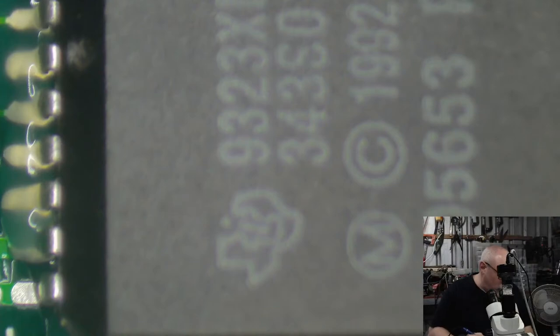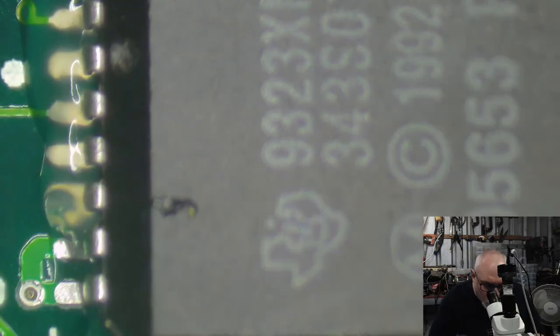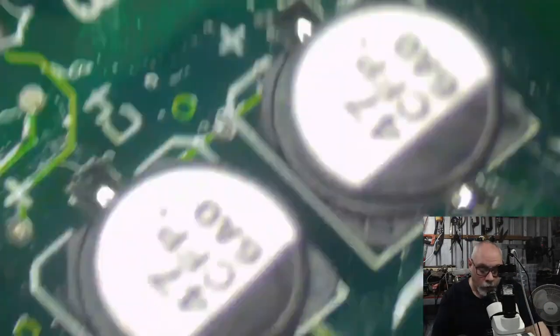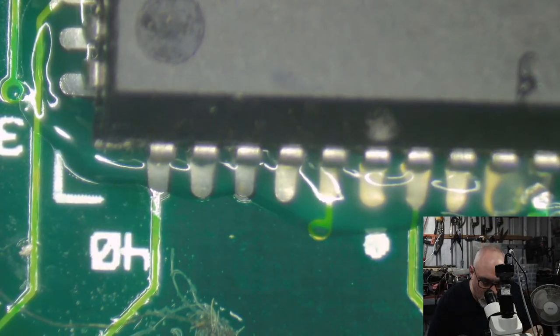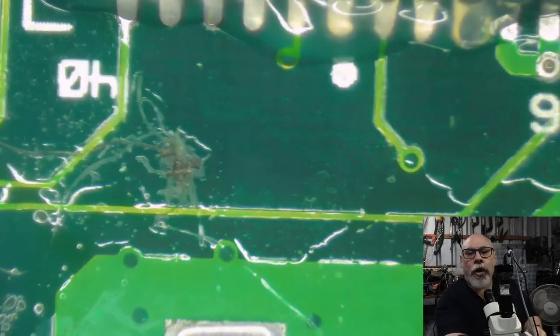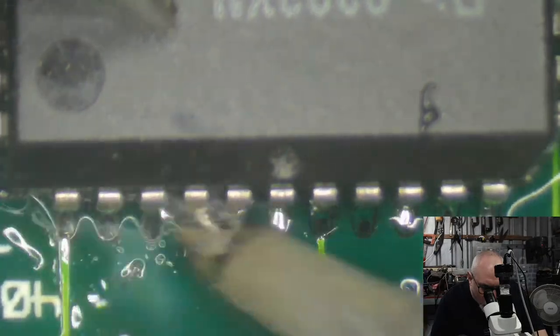it's basically when you check the voltage on it, it's pulsing up and down. What usually happens is it tries to power up, then the voltage is wrong because of a short or something like that. It's pulling the voltage down, making it lower than it should be. It then goes through a chip that says, hey, is all the power right? And when the chip says, no, the power's not right, it then powers it off. So it keeps trying to start. It keeps going: power on, check the power, power's wrong, power off. And it just keeps going through that cycle over and over again.